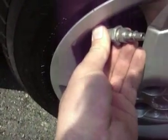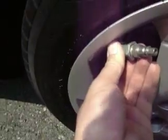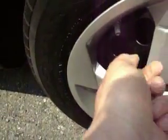Once you do the last tire it's going to be a double chirp, maybe even a triple chirp. There you go — and it tells you right on the dash that 'Learn is Complete.' Hit the info button, go through the other options, and you're back in normal mode. Turn the key off, and at startup it looks like it was successful.